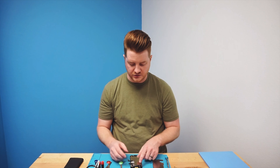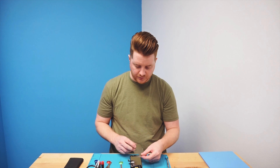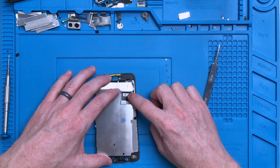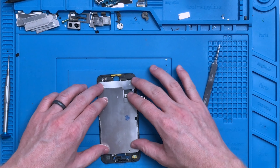And then you'll have display issues or touch panel issues. Now these right here naturally kind of lift up, so that's okay. But whenever we put the back bracket back in place, we want to make sure we push them down carefully and don't apply any hard pressure along the edge of the LCD, because it could cause them to become defused and you'll have a screen with some kind of malfunction or glitch. Whenever you place this back on the device, you can hold down a flex in a safe area — determine that depending on the particular device you're working on — and lay the back panel back in place.